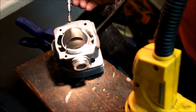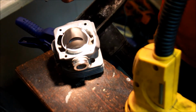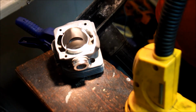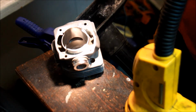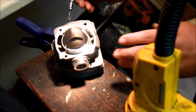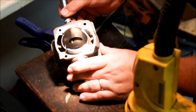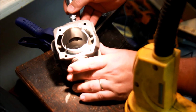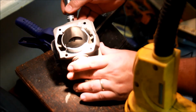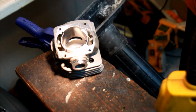But if you make it too flat, the ring tends to hook. And if you hook a ring, you're going to be upset, especially after it takes 3, 4, 5 hours to grind on something like this. So don't hook a ring. Ideally, you want a little bit of a dip right in the center. Just a little bit. That way there's a transition from having a bore to a hole, essentially. I'm going to turn the vacuum on, and we'll give you a little bit of an idea of grinding here.